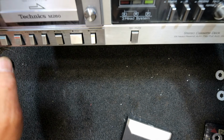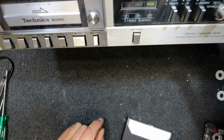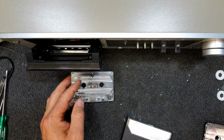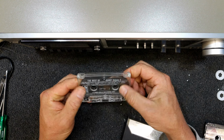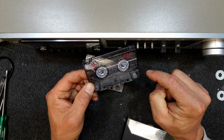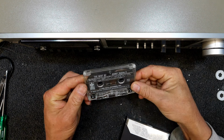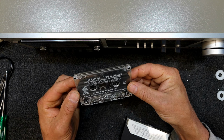It's definitely the tension in the tape, because you can see the actual erase head drop down in this one. That's really strange, unless this deck's playing up more as it warms up. But you can actually see it, because this has got that pivoting erase head, so it's a handy deck to have it in. It's pulling down, and I've changed the reels, the case, and the little plastic bits in there that act like bearings. I was just saying about the TDK, it's got them in there, you can see them, they start about there down to just where that gold writing is, and they're clear. So why didn't all the commercial ones have these horrible grey things in them? I think they would have gone with a nice TDK style see-through. But anyway, unless I didn't put something back in quite right, everything looks like it's sitting there correctly.